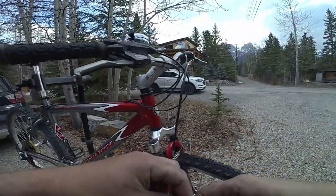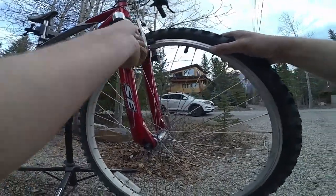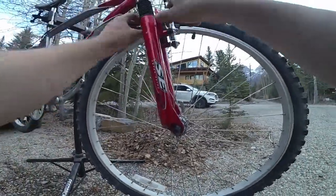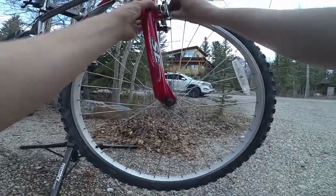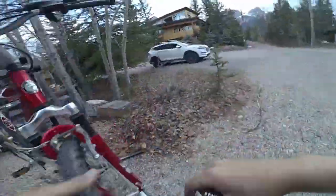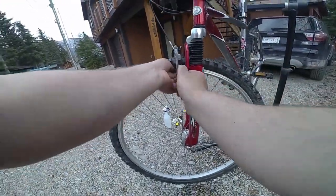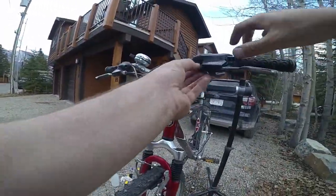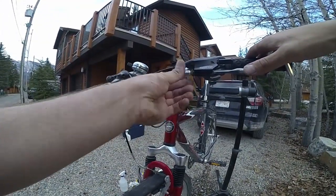On this specific bike we're going to do a few brake adjustments, just realigning the pads on the rim itself. I also went ahead and tightened up the cables on these brakes. This pulls the pads closer to the rim and decreases the amount that you have to pull on the lever to stop the bike.